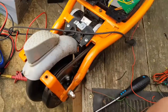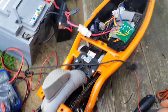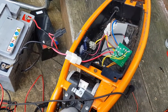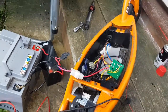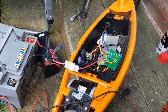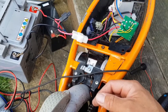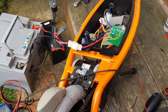So let's put this all back together. This battery is a bit big to fit in there — I might try running it off a 20 or 22-volt lithium battery I've got and see how that goes. Check out my other videos for more on the electric scooters. Just in case you're wondering why I hardwired this to the switch — this is supposed to work once it gets up to about three miles an hour, but this scooter wasn't doing that. I don't know if it was the knackered batteries or what, but I'd much rather just have it on a go switch.